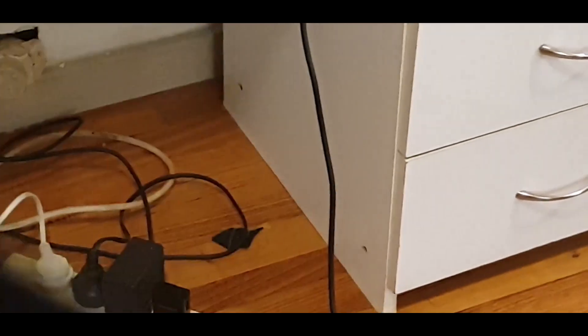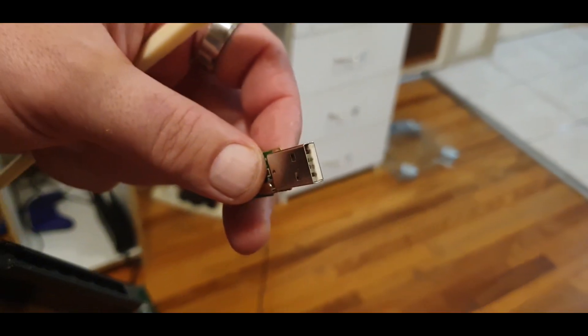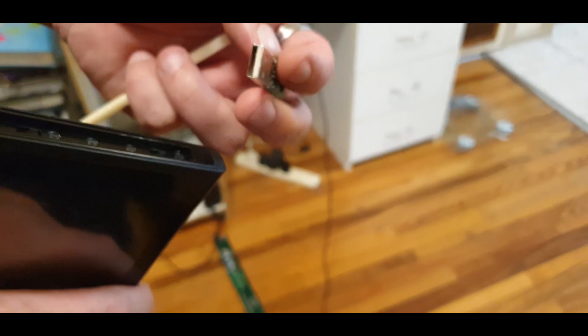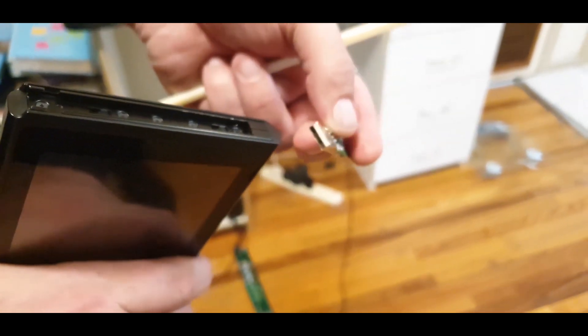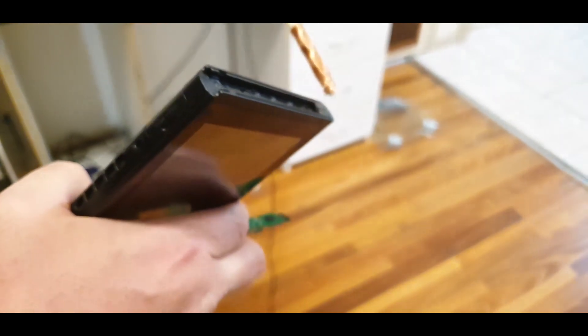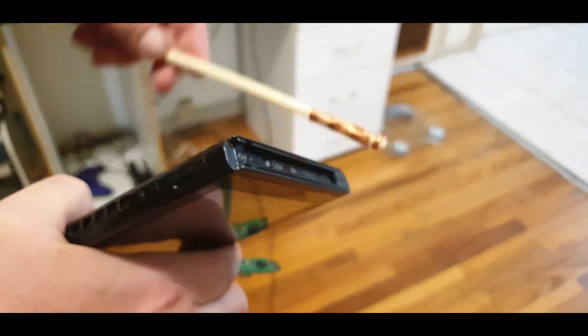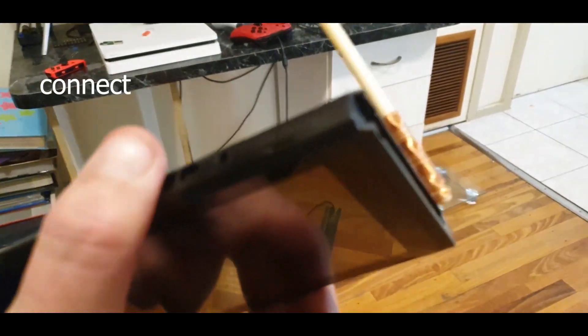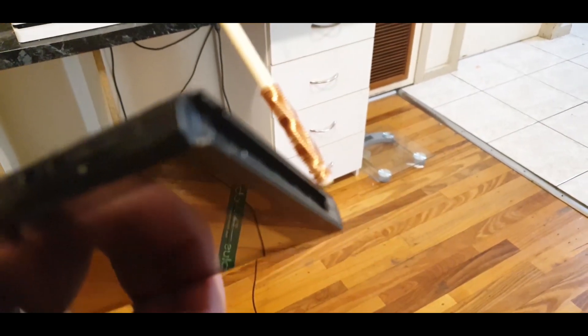Look in yours — you'll see little pins there, like the copper pins on a USB connector. You'll see 10 of them in there, and they're facing inward like that. The pins will be on the outer plastic on the inside of it. There are 10 pins in all. The idea of the paperclip is that you need to bridge pin 1 and pin 10 — the last one and the first one. You must bridge it with the paperclip.